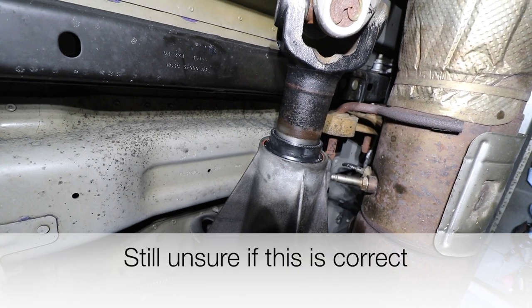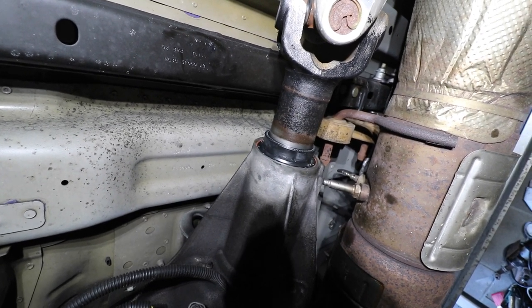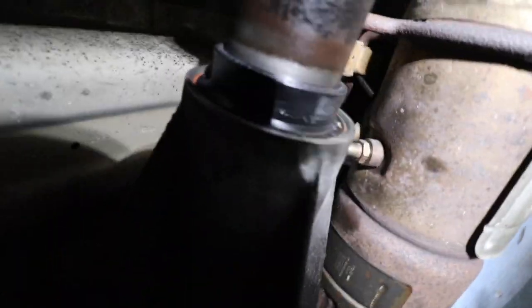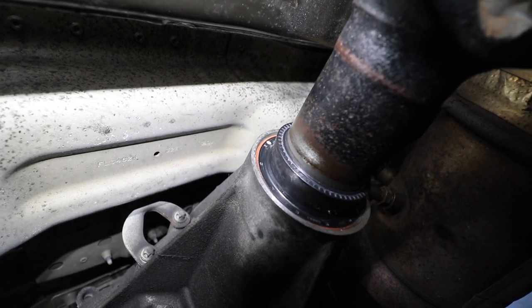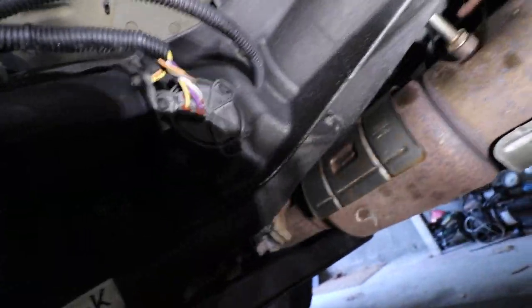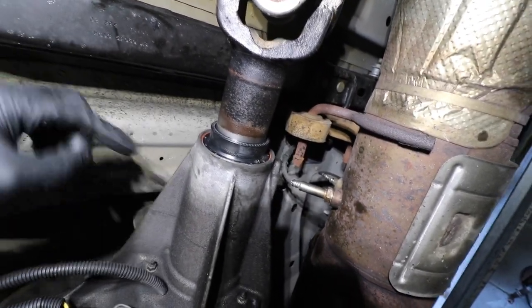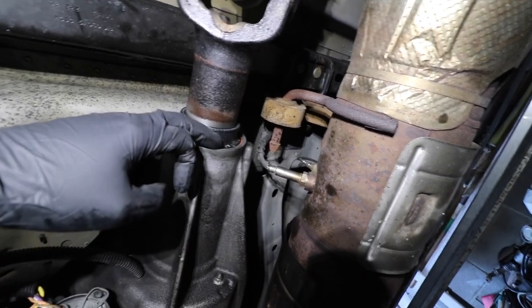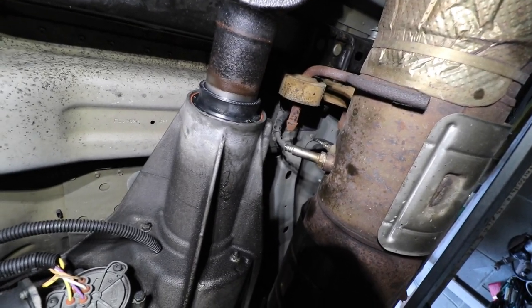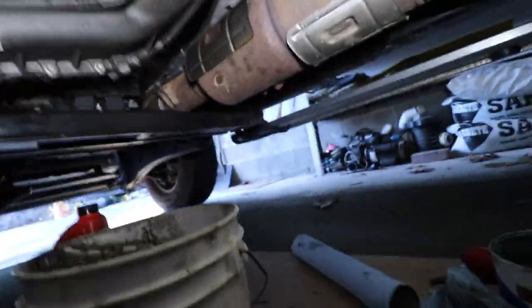I think I made a small mistake I want to flag. I noticed there's a white dot on this seal with a small hole next to it — I believe that's a weep hole. I put it on top, but I believe it's supposed to be on the bottom so that any water that gets into the seal can weep out. I could drill a hole in the bottom, but I don't think I'll have water intrusion, and I do maintain this vehicle well and will be changing the transfer case fluid when it's time.